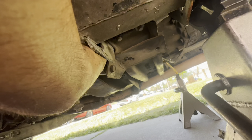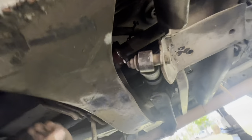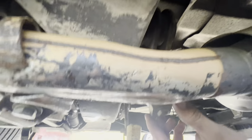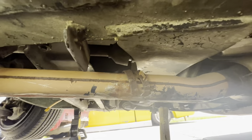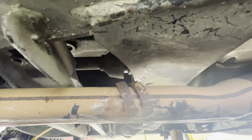Hammer the clip in to get it started. Now that you have your clip back in, the torsion bar can't pull out that way because it'll get caught on that lip. It's going to be pretty much the same thing on the driver's side, just a little bit harder since it's all mangled up. I'm going to straighten the crossmember back out — it's pretty gnarly. I'll probably also go to the junkyard and get a new replacement for it.